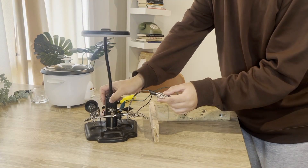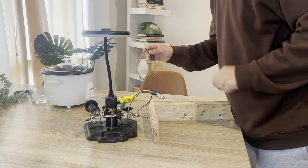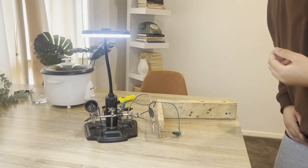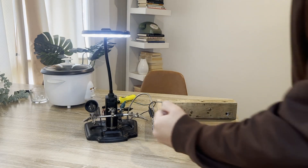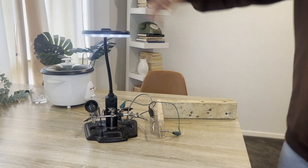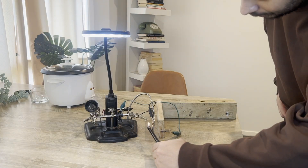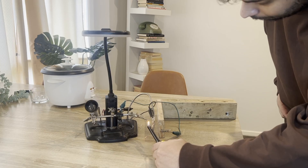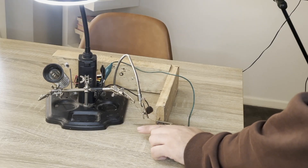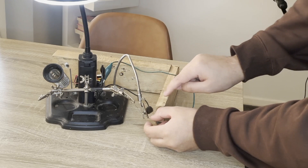I have this light here, and as you can see it turns on and off. Now I'm going to interrupt the circuit with the batteries — I've put some wire in between. We can see the circuit is complete and the light is on. This is just like the rice inside the cooker. Watch what happens when I heat that wire up and it drops. Heat it up — bang, it drops off and stops the circuit. The minute that wire drops off because it's no longer magnetic and held up, it breaks the circuit and the light turns off.